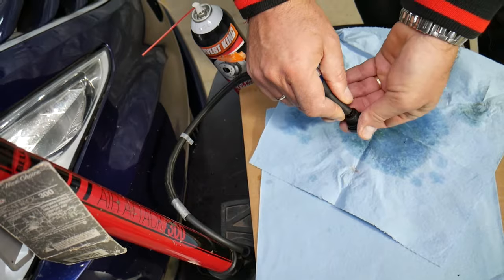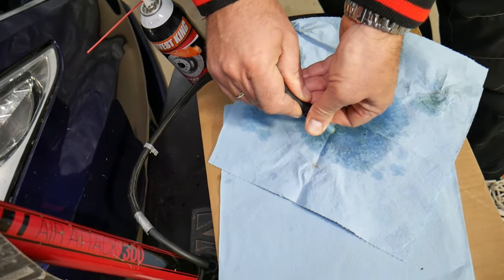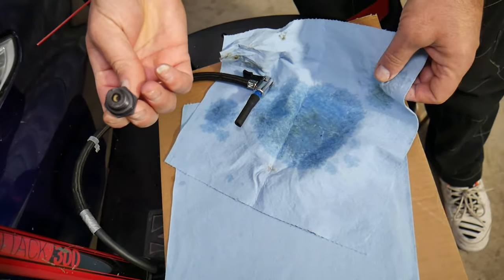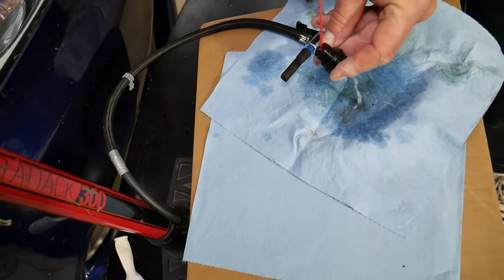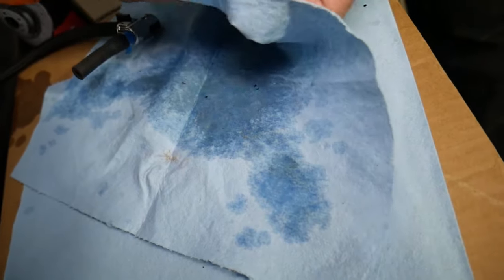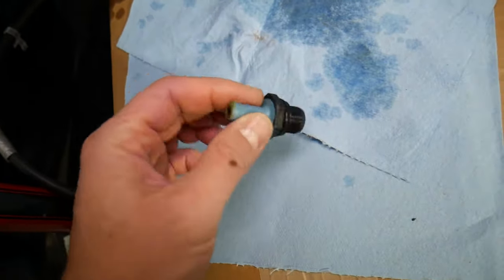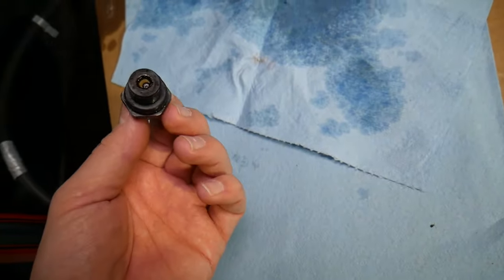We're going to pump it again — it's still not closing correctly, and we can see more stuff coming out. Let's spray a little more on the inside. We can plug the hole and let it soak a bit — fill it up and let it sit. You can see all the fine debris coming out; that's carbon buildup and that carbon buildup is what's preventing it from closing. An even better way to clean it is to fill up a container so you can move it around and let everything come out. It's a very, very dirty valve.